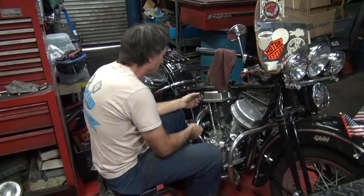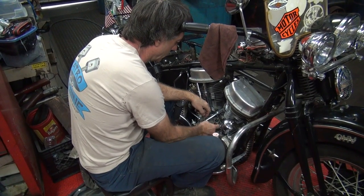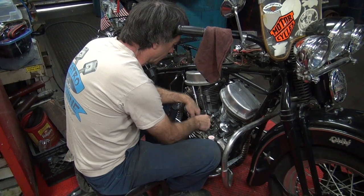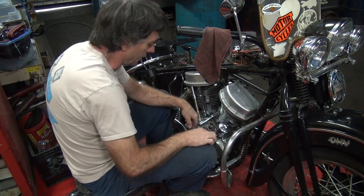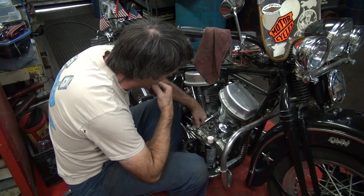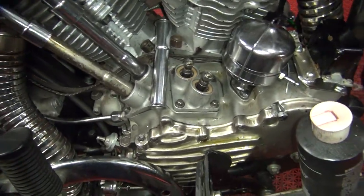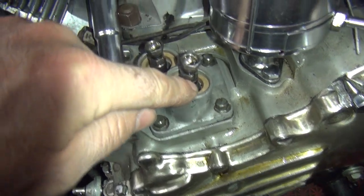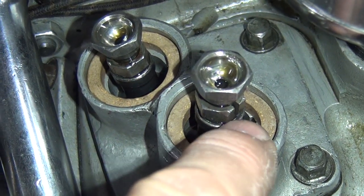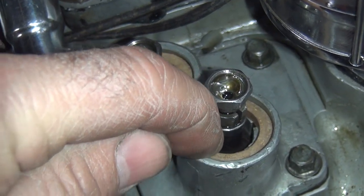Make sure these fit tight in the holes on the OD. They're just a tick looser than what the block is — they're close. When the corks are way undersized on the OD, they usually tend to leak a lot. There's your oil drain hole right there. On these it just has a groove, but you want to make sure the cork completely covers up the hole. On the later blocks you have a hole next to the edge and it'll leak past the cork if the cork's loose. These corks only have about 15 to 20 thousandths clearance on them, which is good.